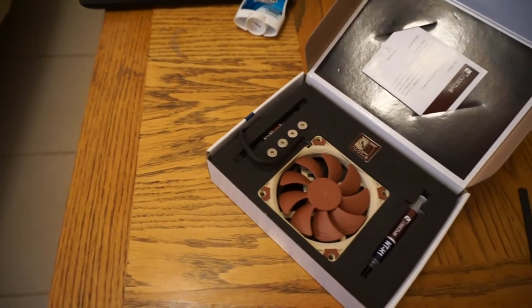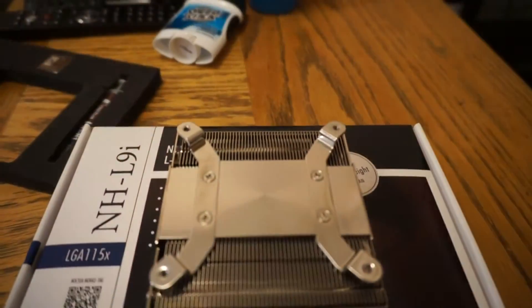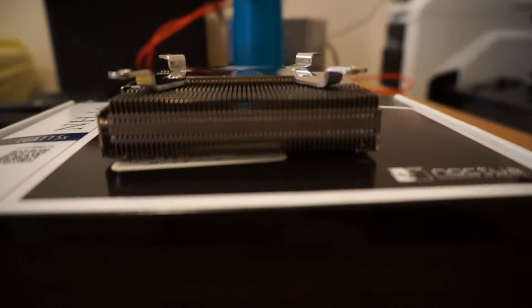What we are able to do now is upgrade it even a step further. I'm going to upgrade the stock cooler — which, by all means, is still really really good, so don't worry about using it in your console killer case — but I want to upgrade to a Noctua NH-L9i, which is a nice small low-profile cooler that is a lot better than the stock cooler.